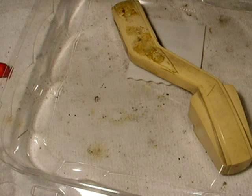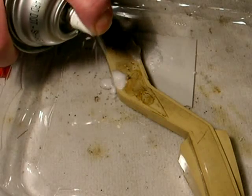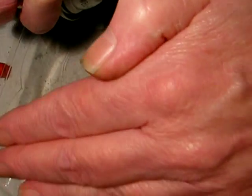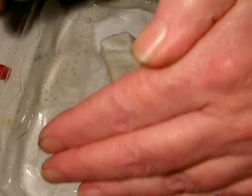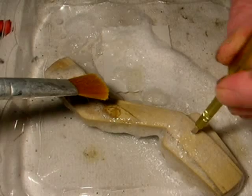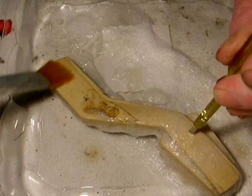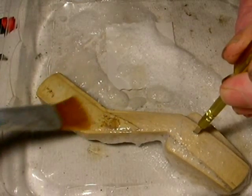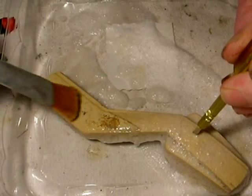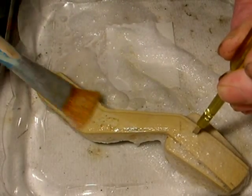Now what we're trying to do is clean this up a little bit. I don't know if this is going to work — this is old dried tape residue from people gluing or taping nickels on top of the tone arms to add tracking weight. We're going to go ahead and put some oven cleaner on this. Let it sit and push it around with a brush here. I don't want to touch this stuff because it's not really great for you. Look at this — how cool is that? See how that cleans it up, removes decades-old tape residue. Let it sit for a few minutes.